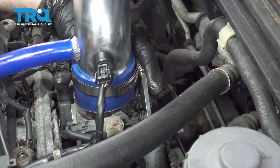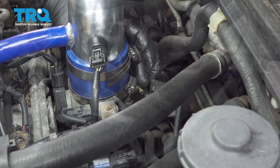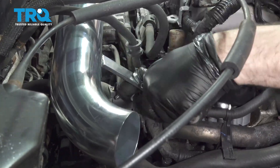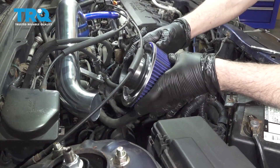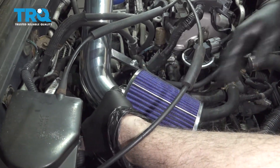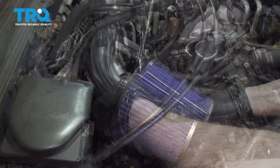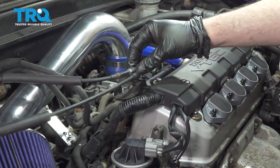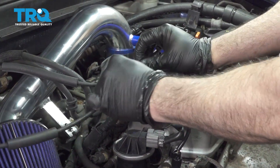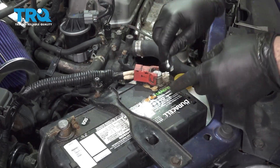I'm going to go ahead and tighten up our upper intake clamp here — snug that down and then repeat for the bottom. I'm going to go ahead and tighten down our nut right here — it's a 10 millimeter. Snug that into place. Go ahead and grab your air filter, have your clamp set on, slide this up into place, and go ahead and snug this down. I'm going to grab your cables here, line these back up, pop that into the bracket as well as this one here. Reconnect your little tab there and your positive battery terminal, and we'll go ahead and snug this up.